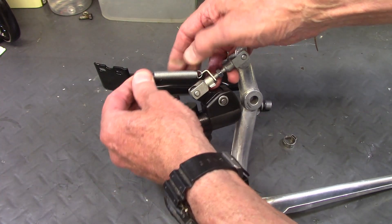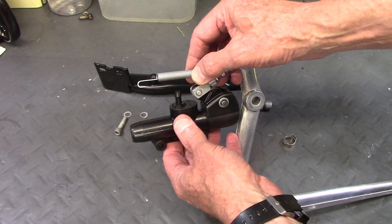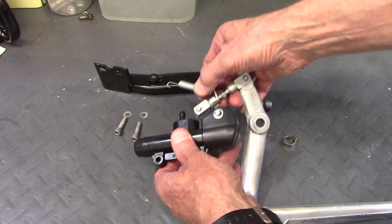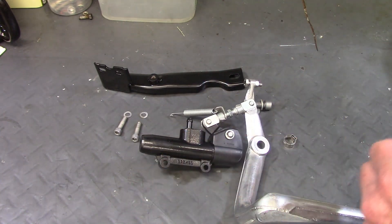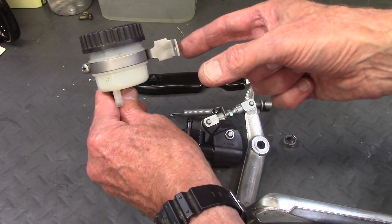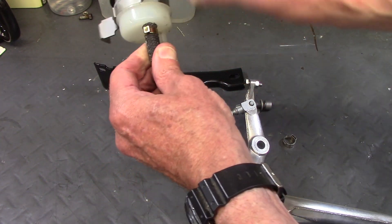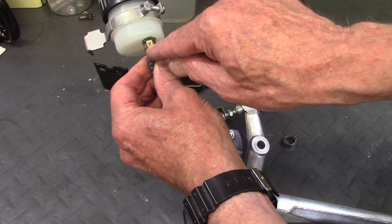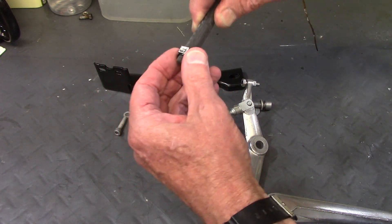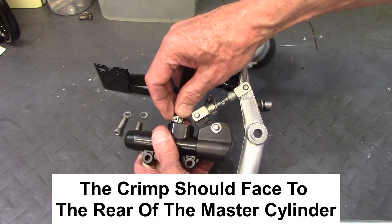There's a return spring for the brake pedal that has a hook end — it fits into a hole drilled in the back of the muffler bracket, and that'll be shown in more detail later. The brake fluid reservoir has a bracket and attaches on the top right of the battery box with a vibration isolator stud. The hose is attached with a use-once crimp hose clamp, and the same is done at the bottom. The hose clamp slides over the hose and is crimped with a special tool.